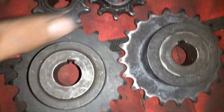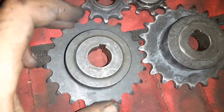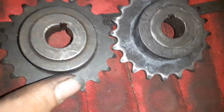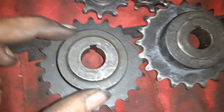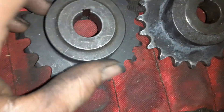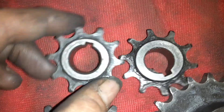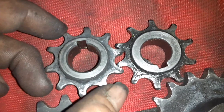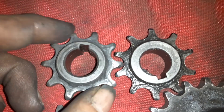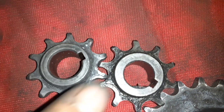With a one-to-one ratio, you don't need this big a sprocket — you could use two 10-tooth or two 22-tooth sprockets to achieve the one-to-one ratio, and there are pros and cons to both. One pro for the smaller sprocket is that you have less rotational mass, but you have less contact surface for the chain on the sprocket.